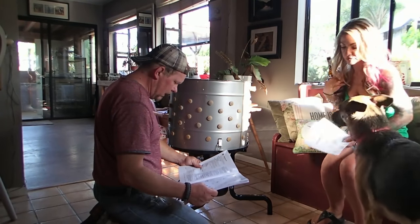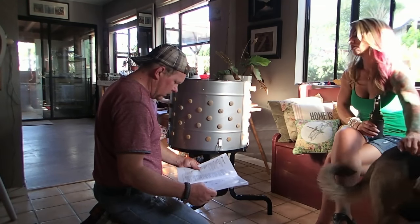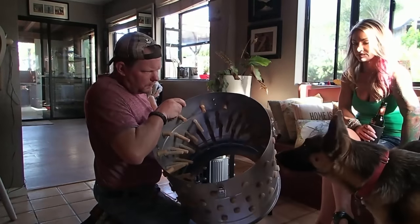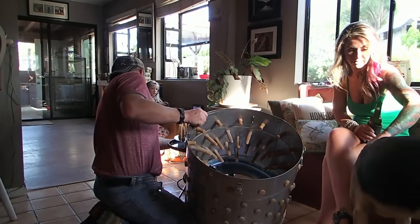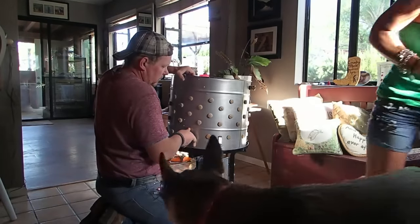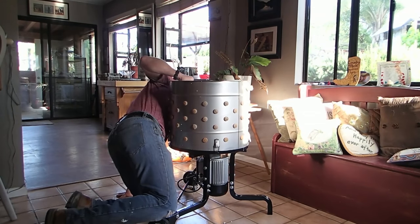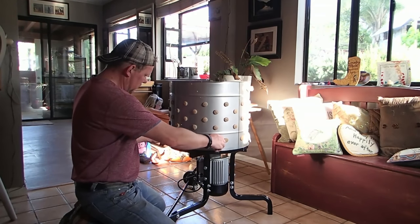Place the tub in the feather pan. The magnetic reed switch in the feather pan must align with the magnet in the tub. This is why it only goes on one way — there's a magnet in here and a reed switch right there. The deal behind that is: if the tub is not on, obviously you don't want that feather plate spinning — somebody could get hurt. So they put a reed switch in there to tell it whether or not it's safe to operate.